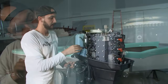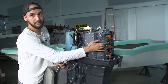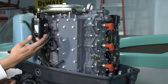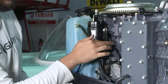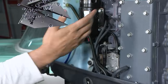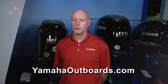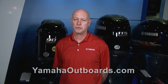What I like to do when I'm bleeding the pump: one, I put oil directly into the combustion chamber behind the spark plugs, and two, I also run it on pre-mixed fuel at 50 to 1. That way, even for the brief period that these lines have air in them still, you're not going to cause any damage to the engine without it getting lubricated. If you're unsure about how to replace these lines, you can take the motor to your local Yamaha dealership or pick up a service manual, which will illustrate how to do it.